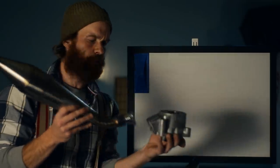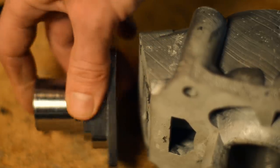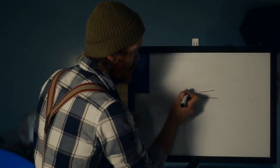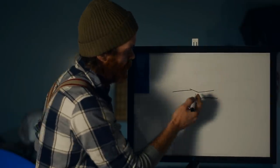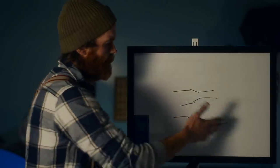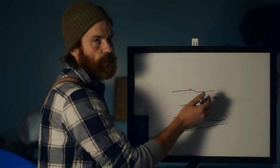Between the exhaust duct and the actual pipe there is a short transition piece, which brings the diameter of the port exit out to the diameter of the header — 100% of the effective area of the exhaust port. It's a short transition: here's the duct, here's the pipe, and it's short — bringing the shape and size of that duct exit out to the round exhaust shape and area. It's easy to think a longer transition would be better so that flow wouldn't detach from the edges, but that doesn't really matter here. There's more than enough room in that pipe for the spent gases to get away. What we want is a sharp transition from high velocity, low pressure to low velocity, high pressure — here we just want those spent gases to get out as quickly as possible.